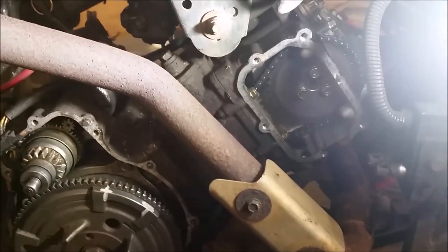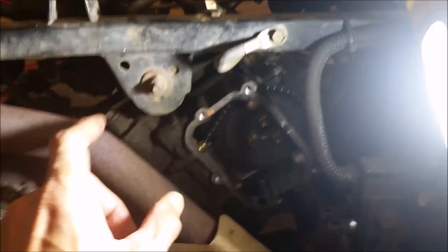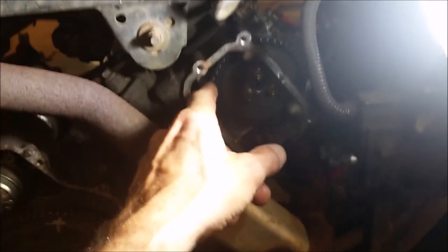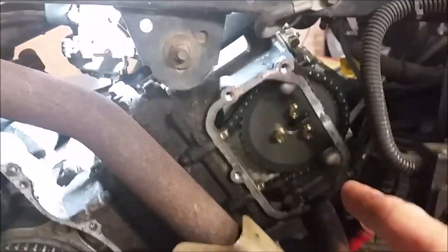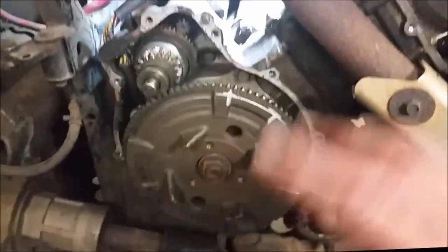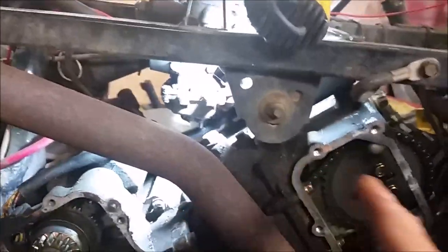So the next thing we're going to do is remove the chain tensioner. If you don't remove that, this chain is going to be tight. What I'm going to do is take these bolts — I'm going to use that wire I showed you and just hang it up here, because if that chain falls off down at the bottom, you've got to pull the flywheel off and readjust everything. So I'm going to try to do it the easy way. I'll take the chain tensioner off, take those three bolts off, hang that up, then take my 10mm socket — one, two, three, four — and that should just come off.